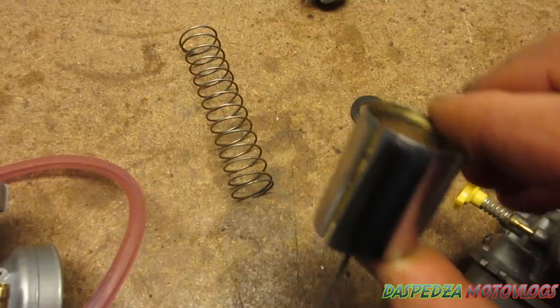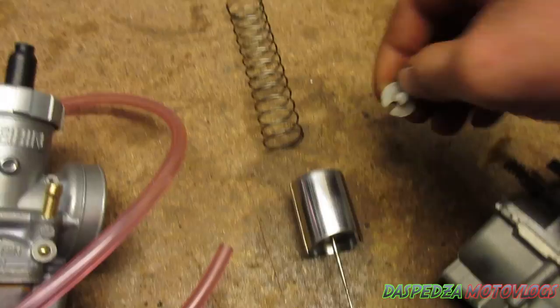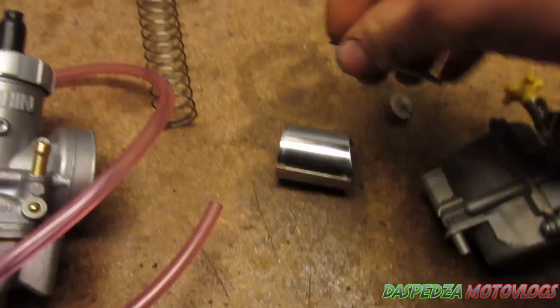In the top of the slide, you'll notice the difference between the fake and the real one. The fake one has a plastic sort of cap to keep the needle in. Now this needle — if you pull it out — it's fixed. There are no adjustment screws or anything on it, so you can't actually adjust the needle seat position at all.